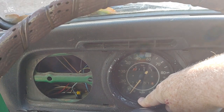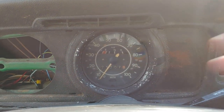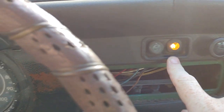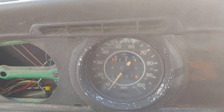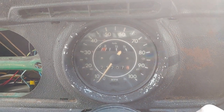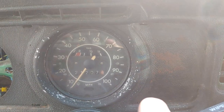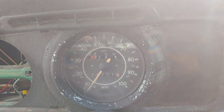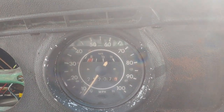If you notice, I still got the lights on. I think that's a grounding problem. If you think it's something else, comment below. I'd like to know. Because it's actually doing the reverse. When you turn the ignition on, you see the brake warning light comes on, but we don't get the oil or the generator. Now, I did test the alternator, getting 14.40 volts coming out, so we are getting a charge. So they're reversed somehow. And what I mean by reverse is when you turn the key on, those lights should come on. And when the car finally cranks over, they go off. So I still got to work a couple little bugs of that out.